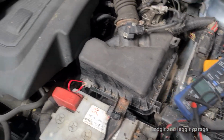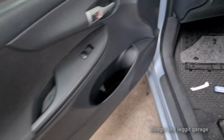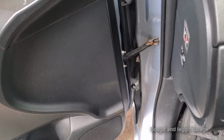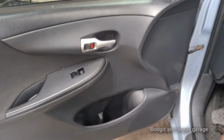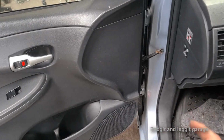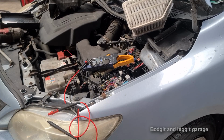Hi-okey! So, just like if you're working on a door, for example, there's a problem with the electrics in the door, well, the first place to always go to is here, because that's what always gets open and closed, open and closed. Them wires always move. And if them wires always move, that was just me checking the fuses. Oh, I must show you how to check the fuses. So if them wires always move, that's the place to go to first. So, I'll just show you how I was checking the fuses, because it's handy to know. It's handy to know, and it's very simple.